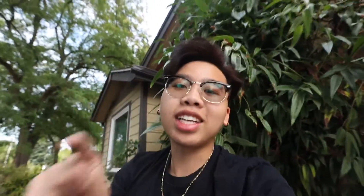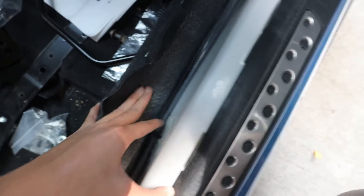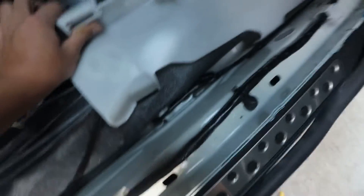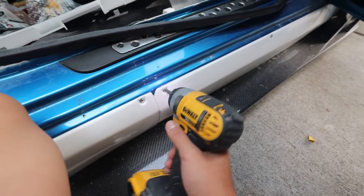First of all, ignore the mess that's in the car. First thing you want to do is take off this piece so you can access the back — this is held on by staples. You can either pull it off or pull off the staples, so I'm just going to yank it off. Now we can reach the back of this. We also need to take off this trim right there, and this piece which just pops out, and now we have access to the metal part that we're going to drill through.